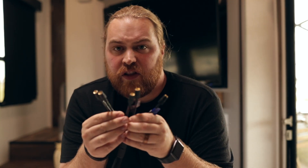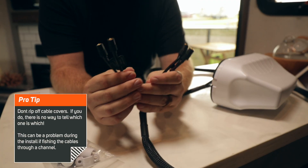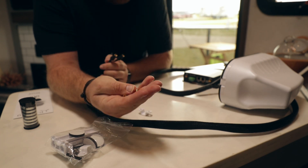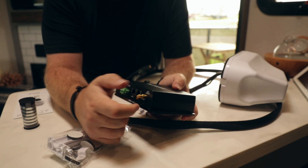With the 5-in-1, it is one antenna with five different things that it does — hence its name. Each of these cables is going to be color coded for where it needs to be connected to on the PEPWAVE. There are two adapters in the back — these two gold adapters are for the Wi-Fi connections. You can put these on the PEPWAVE side or the antenna side; it doesn't really matter which way they go. But it won't connect without them, so make sure you don't throw them away. They just screw right onto the ends.